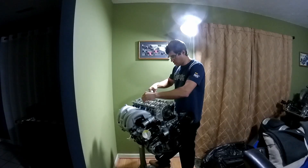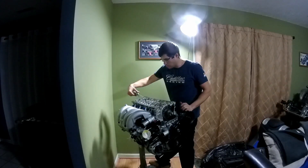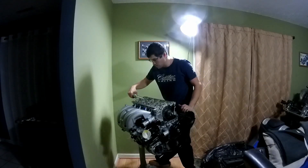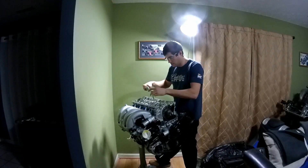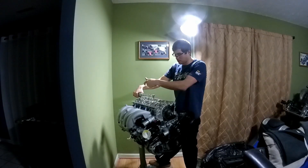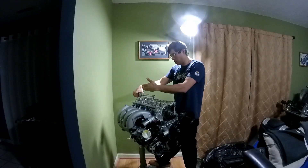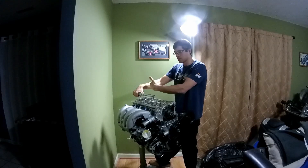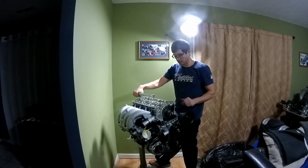Of course, it's a little bit easier when it's in a car probably, because you don't have to hold the motor when you're torquing it. Something else I like to do when I'm torquing stuff - you always usually have to feel if you've got bolt stretch, where you're still tightening it but you don't feel it actually torquing up. Because I always pay attention to how many degrees of rotation I get before the torque wrench actually breaks or clicks.